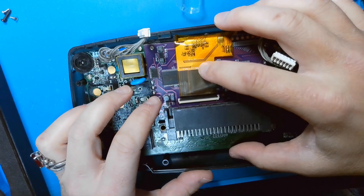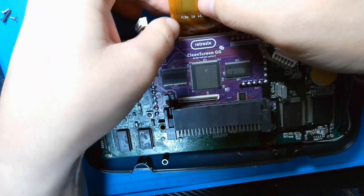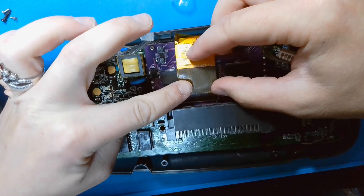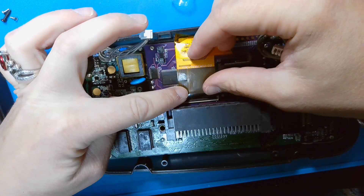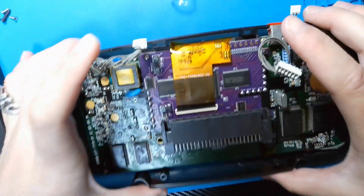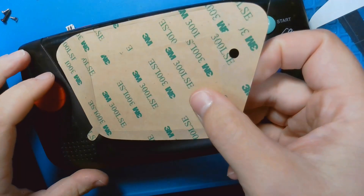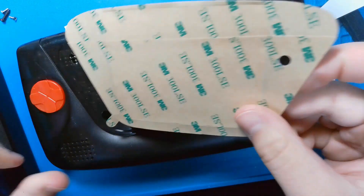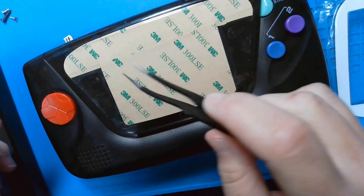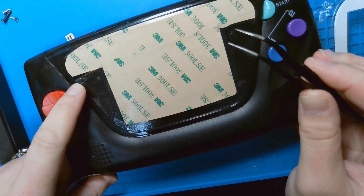After a couple of tests of the screen I did take it apart again. The connector on the back that connects to the board was very tight so I decided to loosen it. Each one I've installed always seems to be a little off, a little crooked — I haven't been able to get it to line up where it doesn't look like it's struggling to reach the ribbon cable. I decided to take it out and try to put it loosely, but I am worried that I may have damaged the cable.